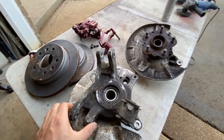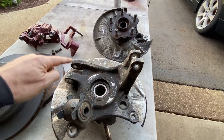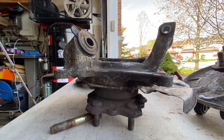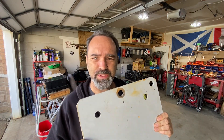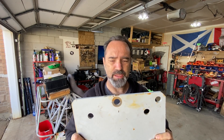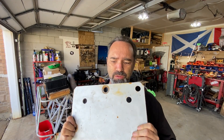My plan is to remove that, remove that, remove that - I want this as flat as possible. I'm going to cut some of this quarter-inch steel to shape, big hole in the middle, bolt it onto the hubs once I flatten them out and then weld on a couple of bush bracket things so that we can then connect it to the control arms. I do sort of have a plan then.